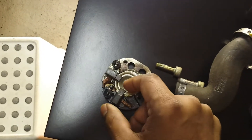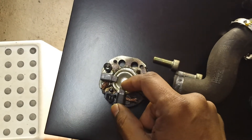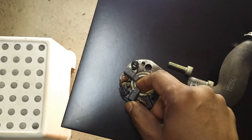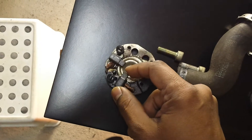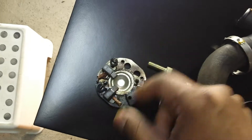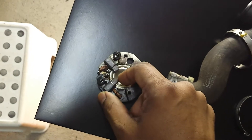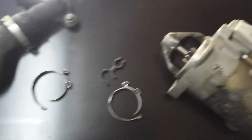The coils were pretty much almost disintegrated and you'll be able to see it was quite badly damaged, which is why this starter motor wasn't working properly and eventually started giving up because they wouldn't make proper contact. I also found that the carbon connector was stuck at the back because all the burning material was getting jammed in the spring, which wasn't allowing the carbon point to come out and make good contact with the armature — the spindle in the middle. It was already broken so I decided not to repair this.